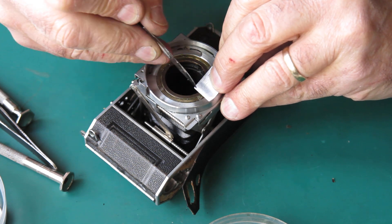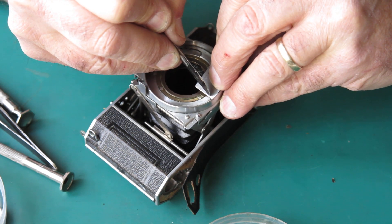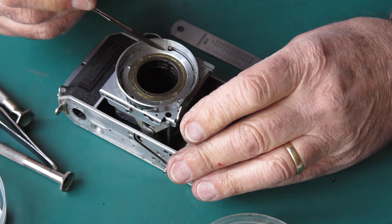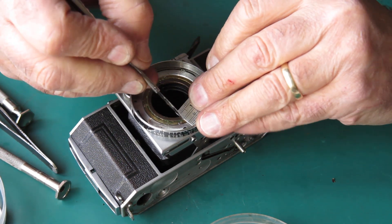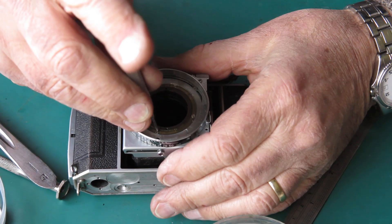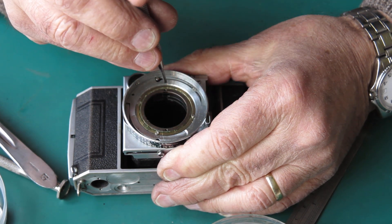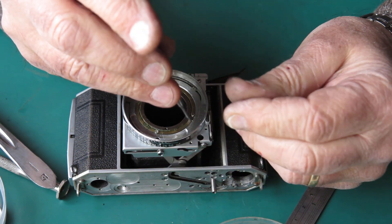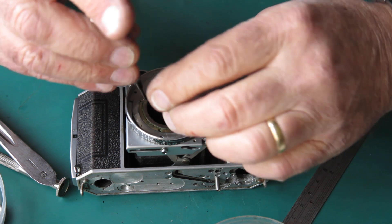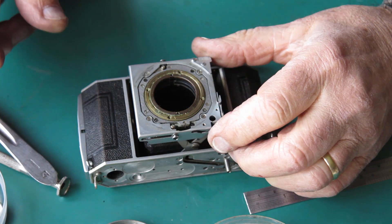There's a bit of someone's hair there, not mine. We'll put two lines here at the base from my focus scale ring to the outer helical, and I'll put one across the top. I'll scrape that in with the end of a scalpel. Now, it's not uncommon to find other alignment marks that other people have put there on previous occasions. If you can decipher their marks and work out what they were intended to say, then by all means just use them.